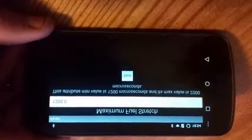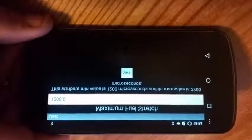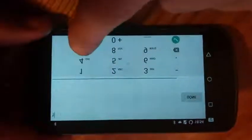Typically, stockish trucks, maybe 100 horse injectors, are going to run a wiretap setting in the 1600 to 1900 range. My daily driving tune is at 1750, so we'll do 1750.